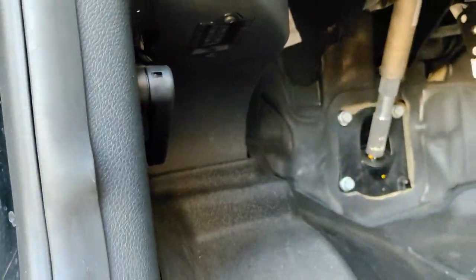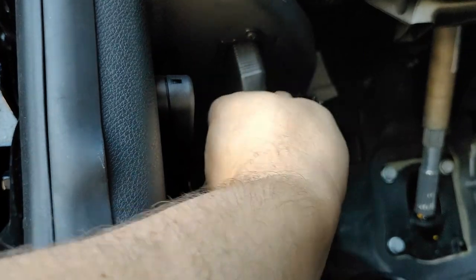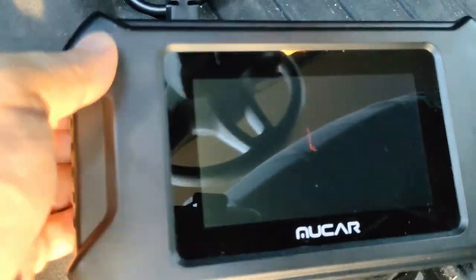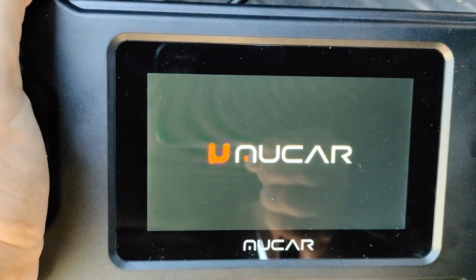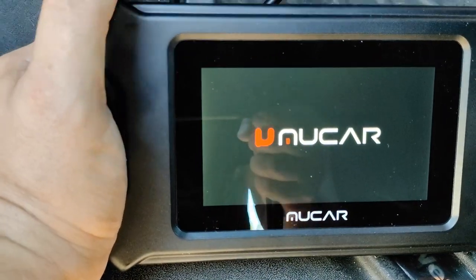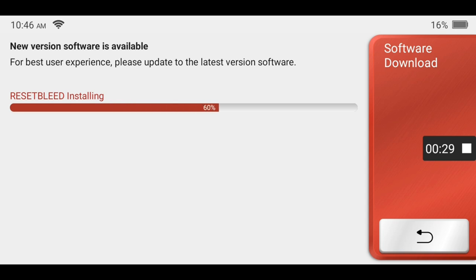To connect OBD2 scan tools to your vehicle, find your OBD2 port — mine happens to be right there. The connector just slides right over the plug and once you slide that on you should automatically get power on the unit. I always recommend having a Wi-Fi connection when you're first connecting this, so maybe hotspot your phone to the unit. It'll fix any last-minute software glitches, do the final update, and when connected to the internet it will let you know. If you ever have a failed update, go under settings and find the over-the-air update section — update the firmware first before doing any future updates.